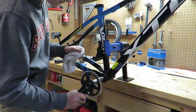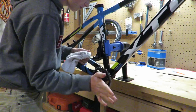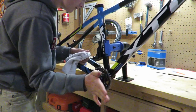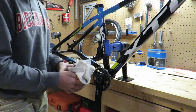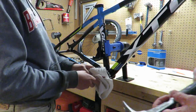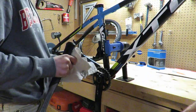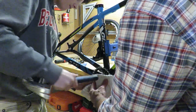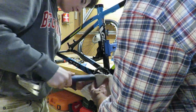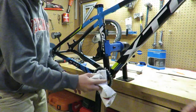We went with this because we thought it would be the most simple drivetrain. I knew I didn't need a big array of gears, so we figured 11 would be enough. There will be more videos in the future on how it has been working. To install the 1x11 Shimano Deore XT M8000 drivetrain and crankset: the socket that the crankset fits into was pressed into the frame by our local bike shop. Once done, we thoroughly lubricated the surface of the crankset and slid it into the socket — a quick punch of a rubber mallet to a towel on the crank will put it right in.